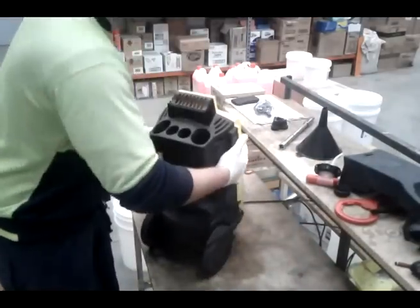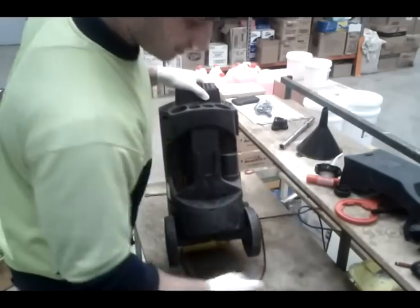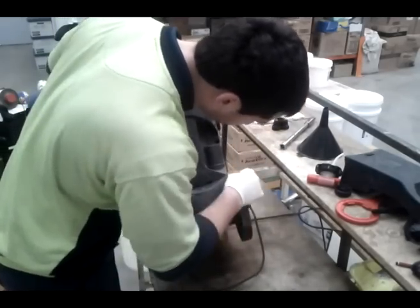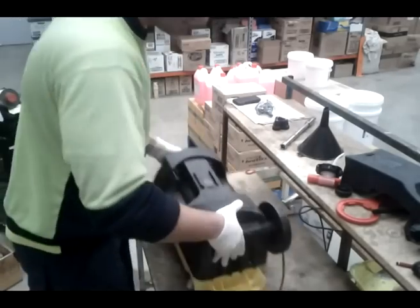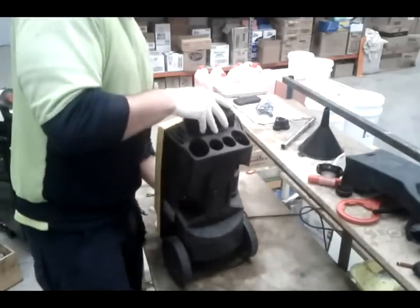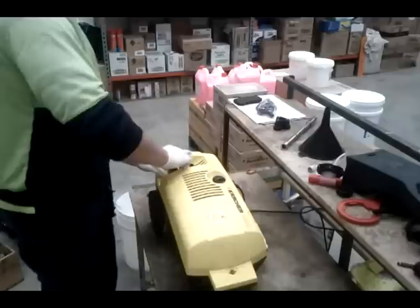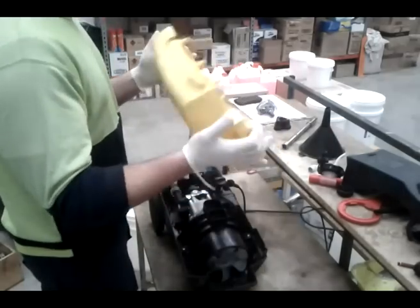Then you want to get to the back of it. I'll lift it up. You need one of these hex and an Allen key to fix it. Now there's screws here, here, here, and 2 down there, 2 here, and then the back cover should come off. I've already undone them, so I'm going to flip it back over. Once you've undone all the screws, flip it back this direction. You'll need to pull this off, like so, and unscrew this here. After that, the whole front cover should come off fairly simply.